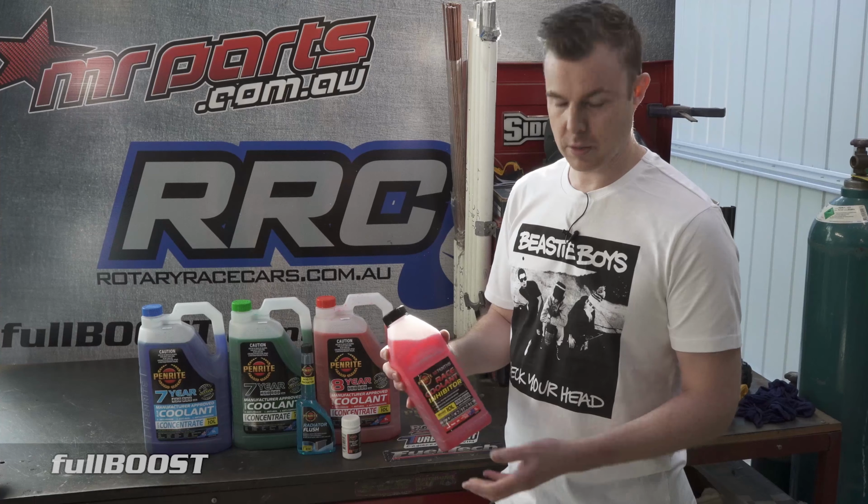So we're here with our Project F350, Cleveland under the hood, standard style radiator, normal green style coolant. What we're going to do here is follow the directions exactly as it says here, and it says dip sample in for 2 seconds, shake briskly once to remove excess coolant, and after 40 seconds compare to this strip. So here we go, 1 and 2. All right, so we'll give this 40 seconds to change color. Let's go back inside the shed and compare the results.